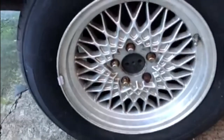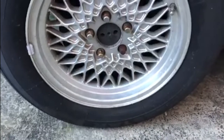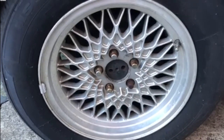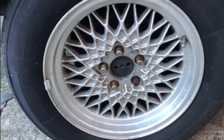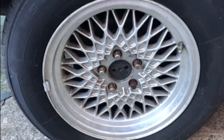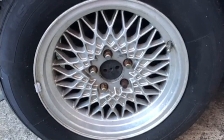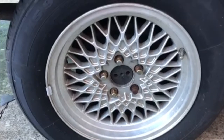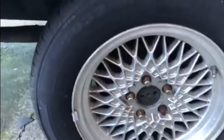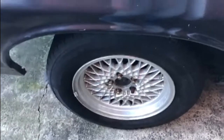Speaking of wheels, these are the wheels it came with and I don't like them. They sit inside the arches far too much and are pretty much swallowed up by them. They appear to be some sort of fake BBS-type wheel on a standard American Ford five-stud fitment. If you're looking for a set of wheels and you like the look of these, leave a comment below or get in touch at 00garage at gmail.com — they'll be up for sale when I get new wheels sorted. They will also fit British five-stud Fords but you'll need a spigot ring as the hub is bigger on an American axle than an English one.